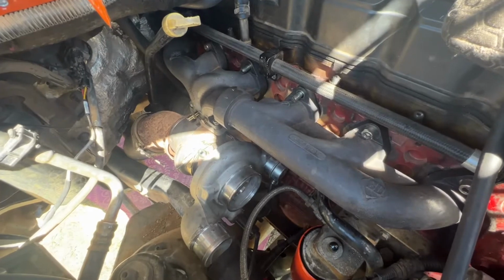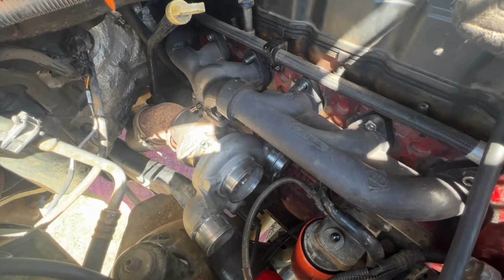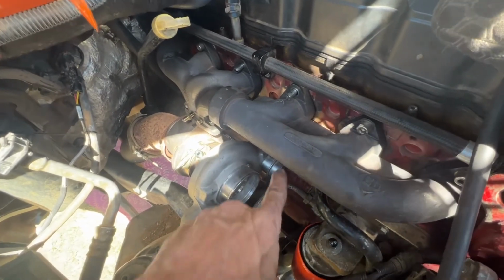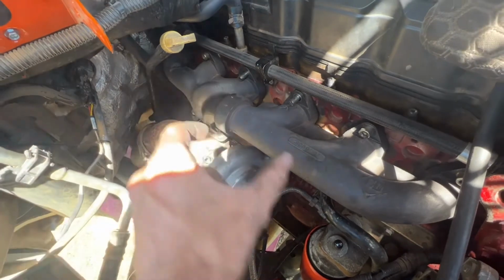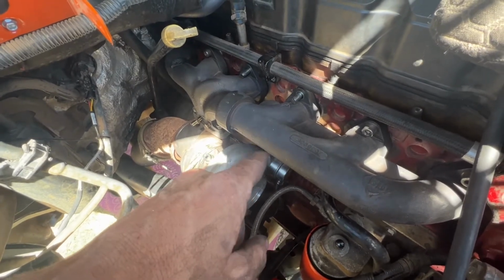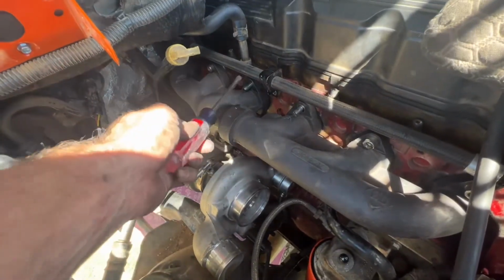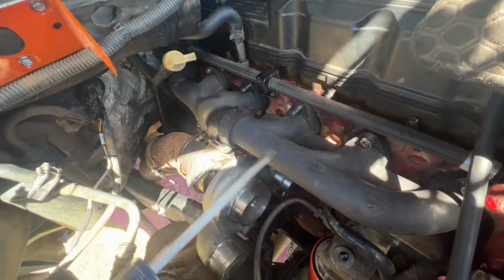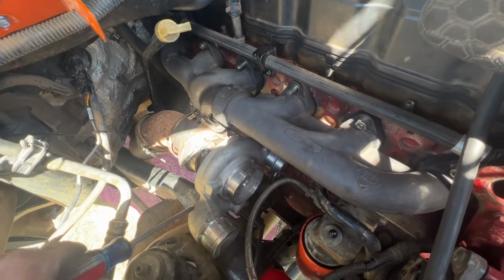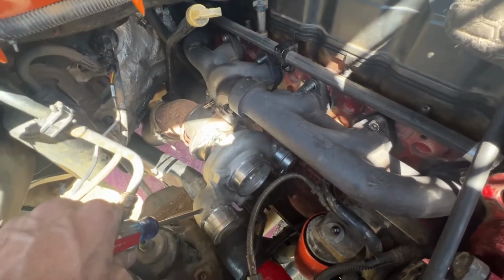Watch the screen for a second and see if you can figure out what the secret is to getting the manifold and the turbo in the truck by yourself and being able to thread those bolts in with the gaskets individually. It's a giant pain. Well, if you look on cylinders 3 and 4, 3.5 inch long bolt with the same thread pattern, and I just cut the nut head off with my grinder and then ground a slot into it for a flathead. So you use the two in the middle there to get it in place, hold everything in place, and then put the bolts in, line up all the gaskets, and it makes it way easier, guys and gals. Anyway, let me get all these bolts in here, and I'll be back.